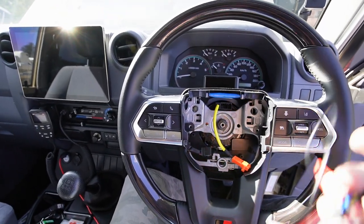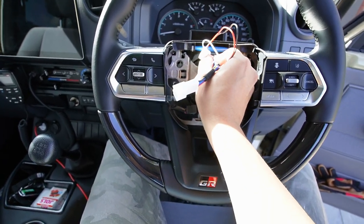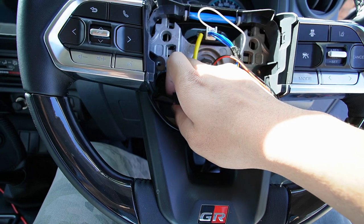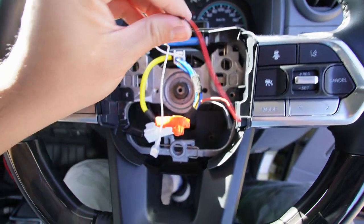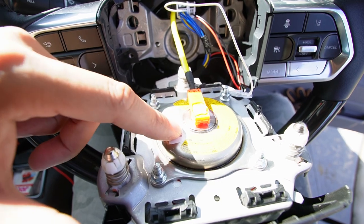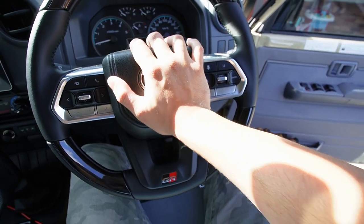It's looking good. The final part of the install — we're just going to start plugging everything back in. The harness which is supplied with the kit is a 10-pin connector, just push it in there — click. Then plug in the steering wheel controls, and this white connector for the cruise control. With the horn pad, it's just the reverse of the removal: push the orange connector into the detonator and then the yellow clip down, and then the white wire is the horn. Line up the three feet — you'll hear three clicks.